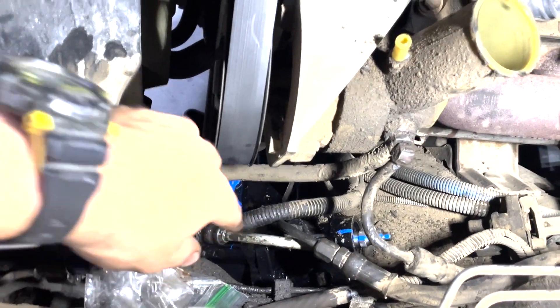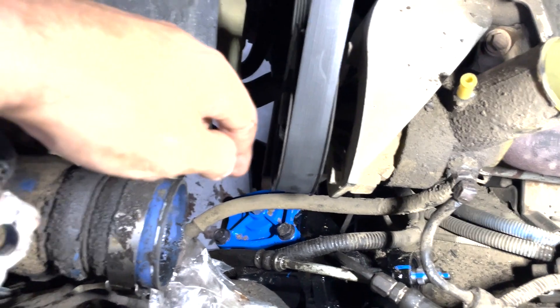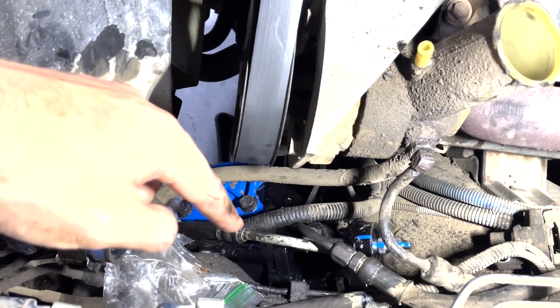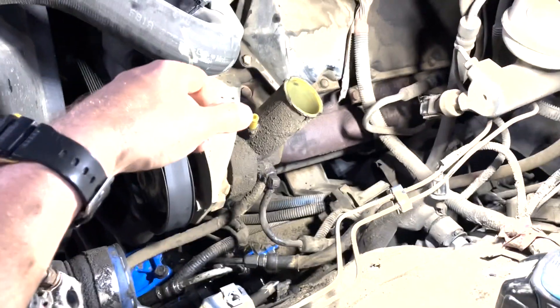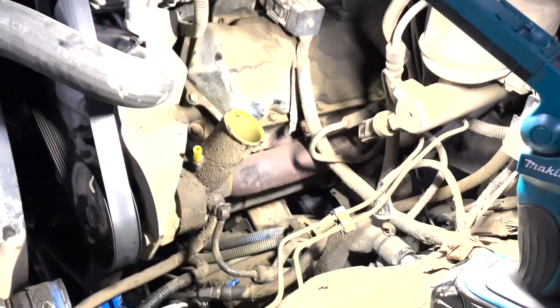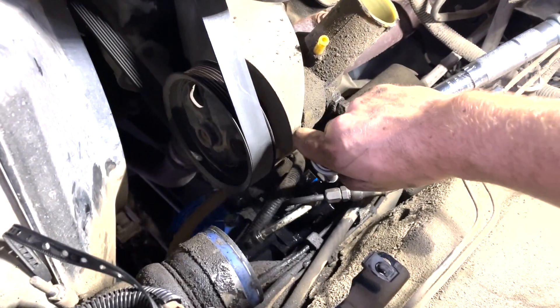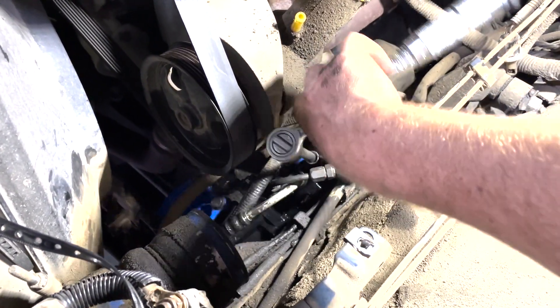Something else I did: I filled up this reservoir with fresh Mercon transmission fluid, because that's what these trucks take, before I connected up these lines. I let it push down through that hose and all the nasty power steering fluid drained out — just let gravity feed it through the cooler and out onto the ground before I hooked up the new lines. Then once I hook up the new lines I'll do a bleed — probably take this return line off up here and use a clear hose to flush the complete system again. I've got my steering shaft attached; I put some blue Loctite on that little bolt, which is a 13 millimeter torqued to 36 foot-pounds.